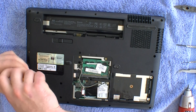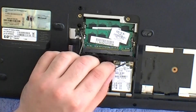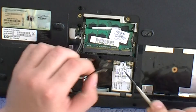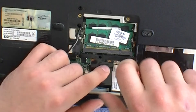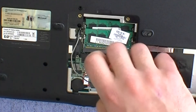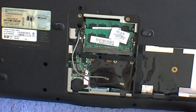This is the wireless Wi-Fi or ABG card for the DV6000. This is a two-wire card, but you might find that you have a three-wire card. It's fine — just remove the wires and replace them back in the same order. In the DV9000 series, you have to remove the two screws that hold the casing to the other side of the laptop.